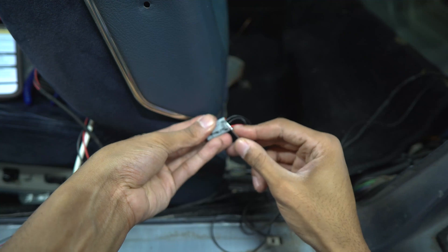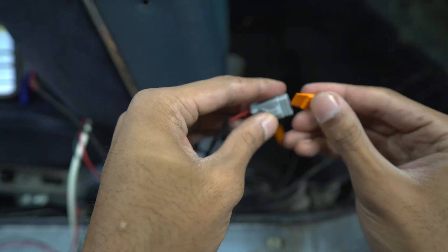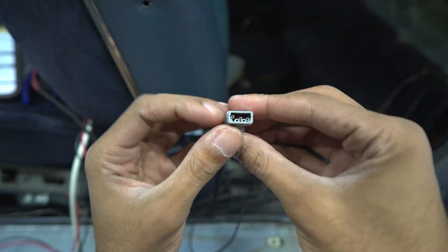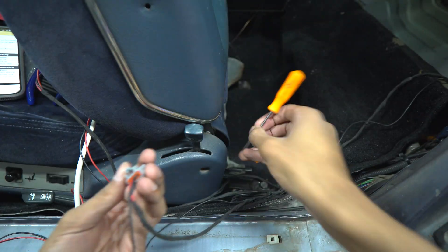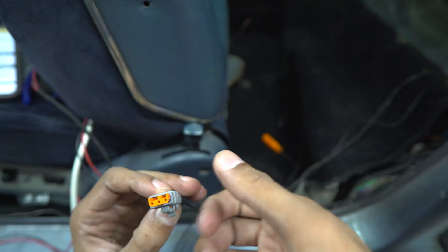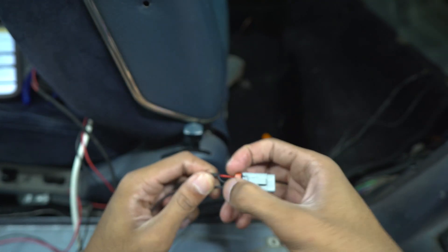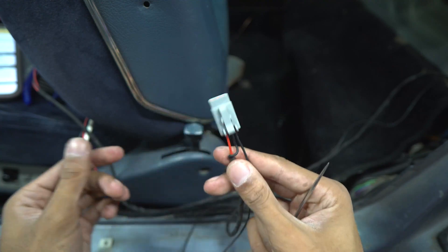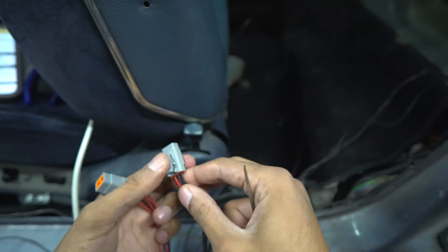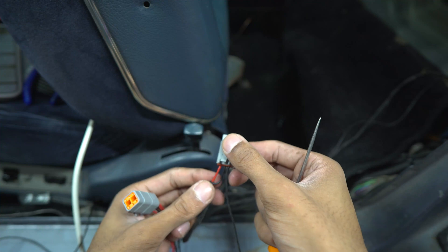I push pin one in there and pin two in here. Pull the housing out to make your life easier, push the pin in until you hear the click, then do the same for the red one. Now I use the securing tab to push everything into alignment — but I screwed up and one pin is bent, so I pull it back out to fix it. Once all pins are in and secure, push the housing back and just like that we have a full connector. If the CAN wires are backwards I'll pull the orange retaining pin, swap them, and we should be good to test.